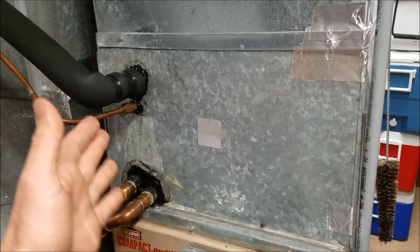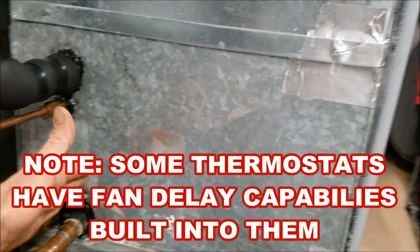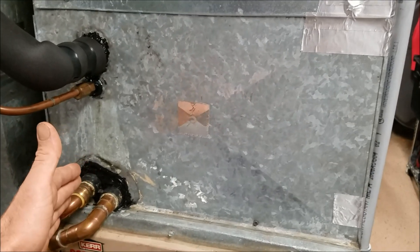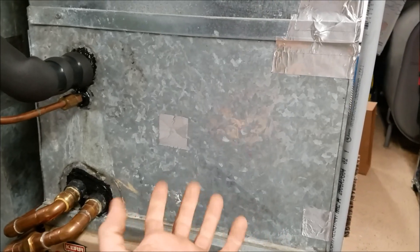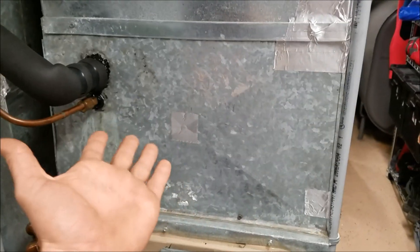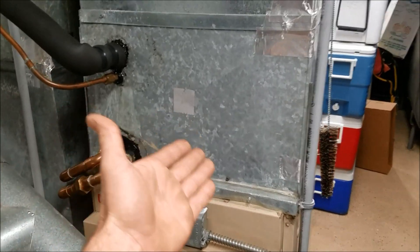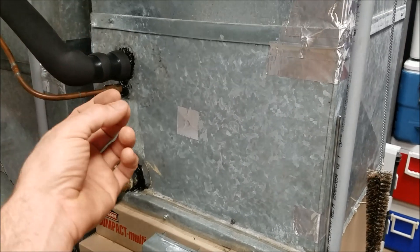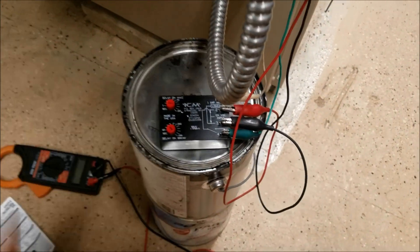The problem is when the AC cycles off, the compressor and the fan shut off at the same time, leaving a dripping wet evaporator core in there with no airflow going across it. This triangular evaporator core sitting in there wet is going to grow mildew and mold — it's gonna get stinky. It can also tend to rot these HVAC units out. I used to scrap these things and I'd see the evaporator cores completely rusted apart, all the steel rusted and even the copper corroded through, because they were sitting in there wet all the time. This device right here is going to help fix those problems.